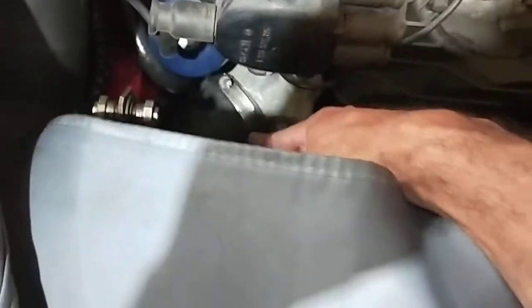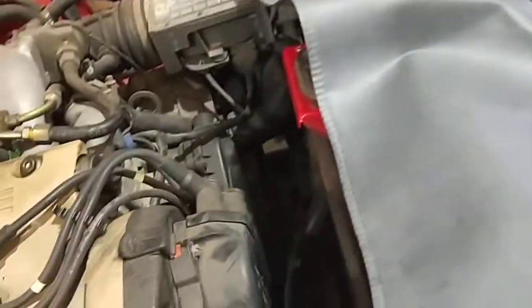Temperature is going up really high and I'm going to show you what I found. The top hose is still cold and that one's hot. Before, that was really cold - there was no circulation. So now I'm going to check for any blockage on this side here. I'll turn it off. What I found is a lot of oil leaks down here from the cam cover dropping onto the exhaust, creating smoke there. I'm going to address that later on.